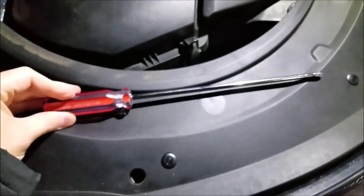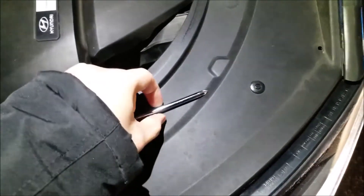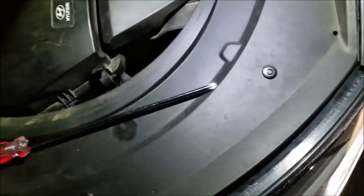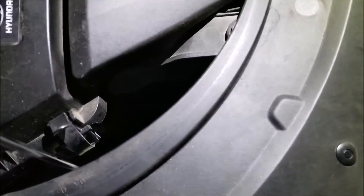It takes quite a few turns before you see a difference on your wall. Put your screwdriver in, turn it towards the car where the arrow is pointing, look at the wall, and put your beam higher. I made mine way, way too high when I was adjusting it and had to go back and fix it maybe two times.